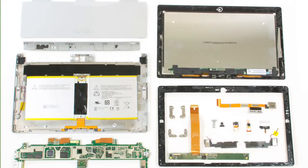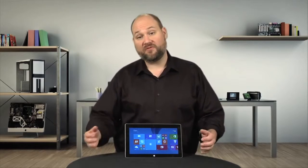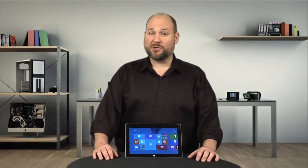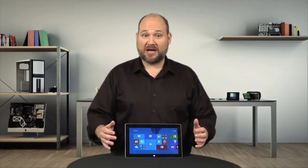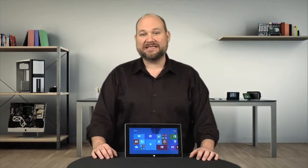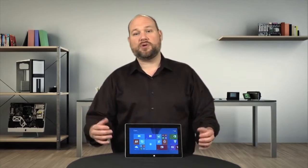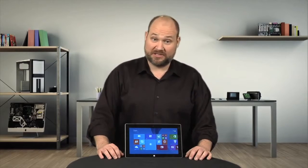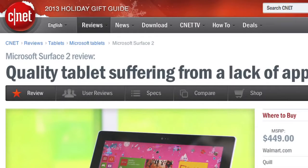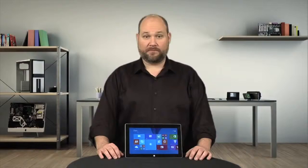It's been a frustrating process, but our teardown is finally complete. The Surface 2 is definitely an improvement over last year's model when it comes to hardware specifications and performance — kudos to Microsoft for that. But it has also officially become the most difficult-to-crack-open tablet I've ever worked on. The front panel adhesive is incredibly hard to work around, there are more than 60 screws inside the case of all different sizes, and most of the motherboard connectors are extremely fragile and easily broken. I can only hope that Microsoft makes some major design changes for next year's model. For more information on the Surface 2, including real-world tests and pricing information, check out Eric Franklin's full CNET review. To see more teardown photos and read my full hardware analysis, go to techrepublic.com/cracking-open. I'm Bill Detweiler — thanks for watching.